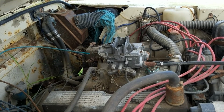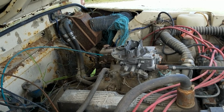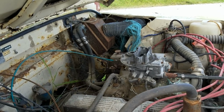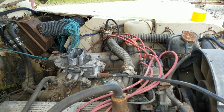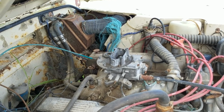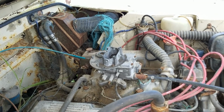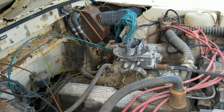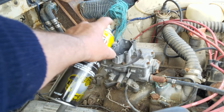By now, any fuel that's been left in this carburetor will have turned to a varnish, so we are going to have problems when we get it started, I'm sure. But I'm very lucky to have this nice twin-barrel carburetor with pump jets rather than the horrible issues that came out on the original beast. It's been really nicely modified. The weld has been polished off, and the manifold almost looks like a genuine manifold.